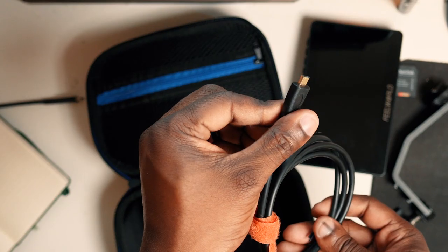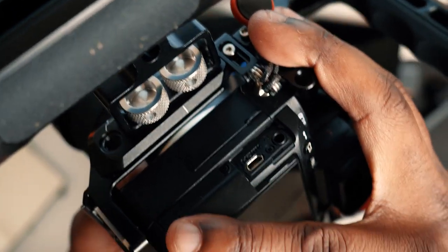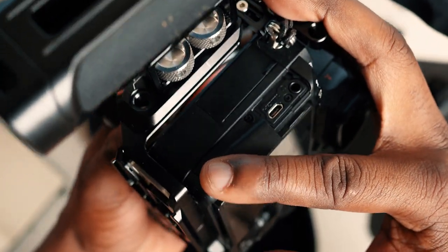How about connecting this to the camera? When you purchase this package, it does come with an HDMI cable — specifically HDMI to HDMI micro. I use Sony cameras, so this isn't a problem for me as most of them have that jack. Just make sure you're checking what your camera actually needs to output an HDMI signal, because you may need to purchase a separate cable if your camera does not include an HDMI micro port.